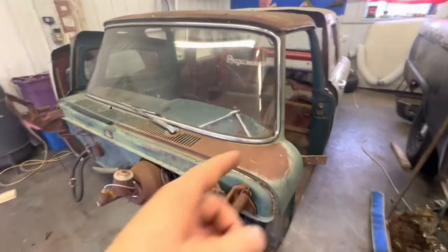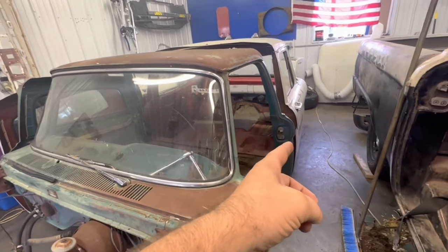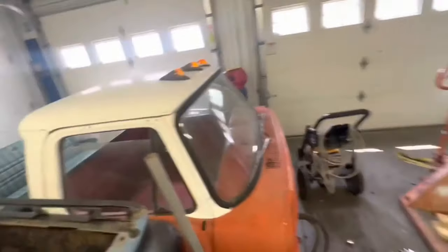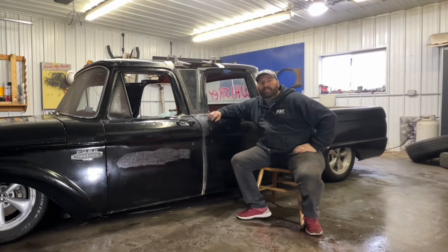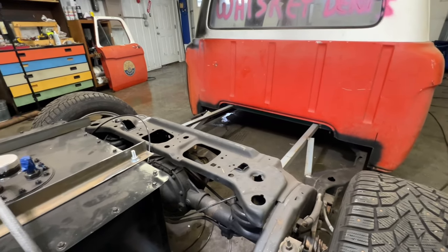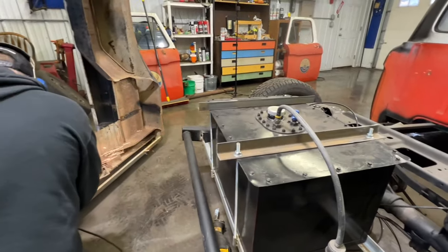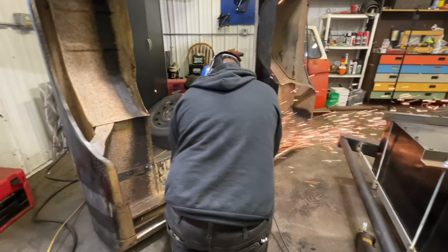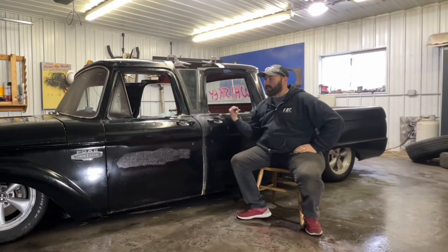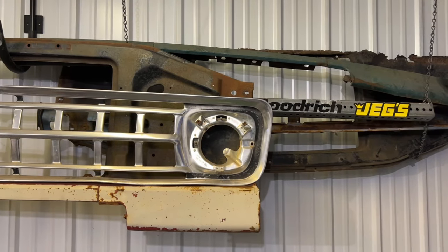So I started rounding up parts. I had three cabs, two parts pickups, and Crown Vic suspension, and I just started cutting and welding stuff together. It's sitting on 2008 Crown Victoria suspension that I added 39 inches to, so it's stretched out. It's reinforced, and also reinforced with the cab mounts themselves because I'm set front, middle, and rear, so the frame should be plenty stiff.